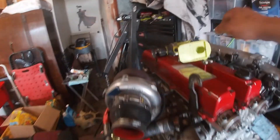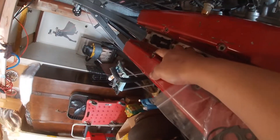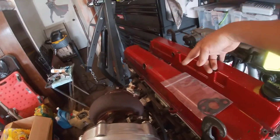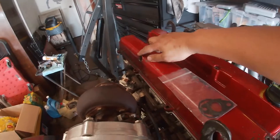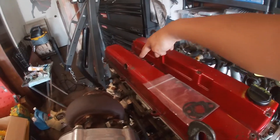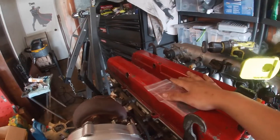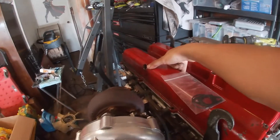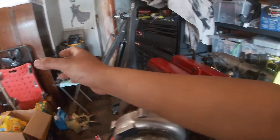I'm an idiot — I accidentally drilled the inner side of the valve cover for the 10-AN fittings instead of doing the outers and keeping the hose in the middle. So I'm going to drill those out, put a 10-AN on the outside here, put a 10-AN on the outside there, and just plug the inners — then keep it vented out. It's not going to affect it. It's still PCV — positive crankcase ventilation — and that's going to be relieved by the AN fittings. I'm bringing them both over to the same catch can.